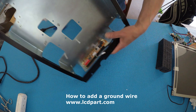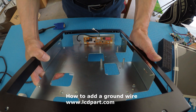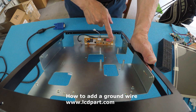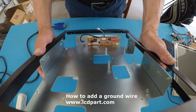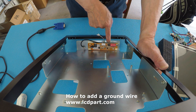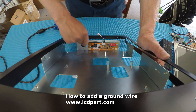What we did is remove the inverters — the original inverter — and mount our LED driver, the 456UB, to here. One end is soldered to the can capacitor negative side, and the other end is connected to the chassis — the metal part. That solves the problem.